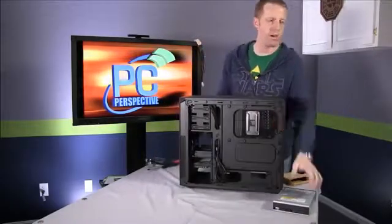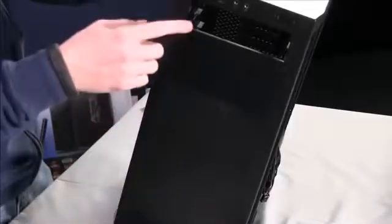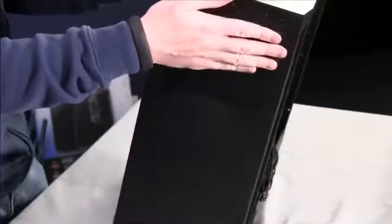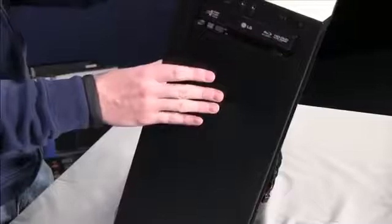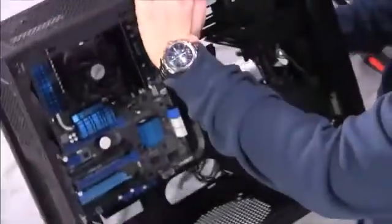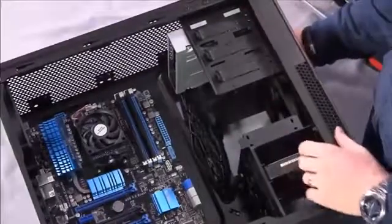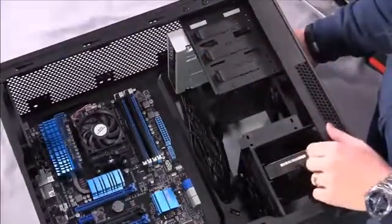It is also, on this 200R, a completely screwless configuration. Just like the hard drive we installed, all you have to do is take the optical drive and slide it in, and there's one clip that you need to be careful for and make sure that you pull it back as you slide it in. And then as it comes by, you hear it latch into place, and now your optical drive is mounted. And again, there are extra screw holes in here for retention, which can actually help with optical drive noise as well, these two up here. So I would recommend installing those.